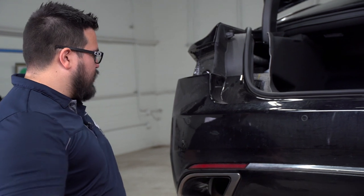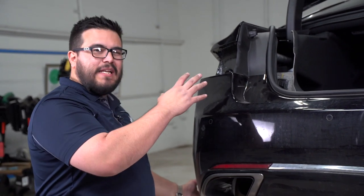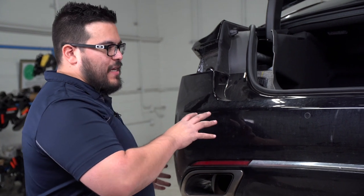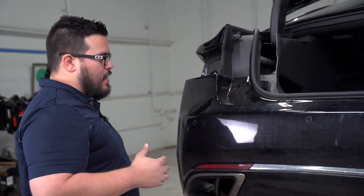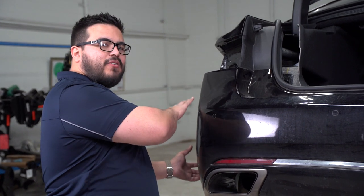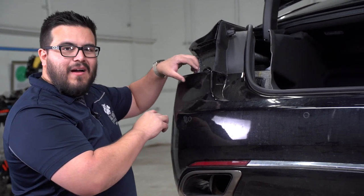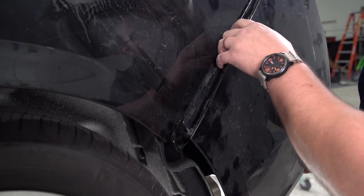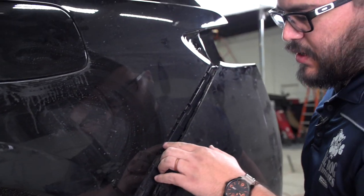It's time to remove the rear bumper. We're going to start on the driver's side — it's pretty easy to get off. The one thing we need to pay attention to though is that this vehicle has rear sensors, the backup sensors, and that harness connects right here. So we'll start at the driver's side and as we work around, we're going to unplug that harness and then continue. This can be done by one person if you just take your time and be careful. Just be careful — you can see where the tabs connect.